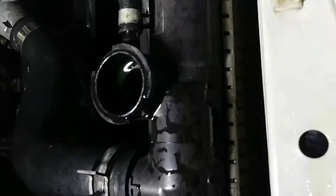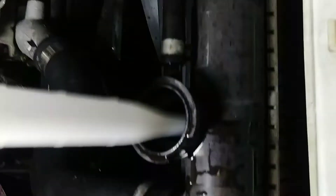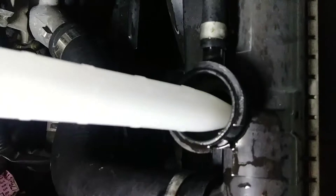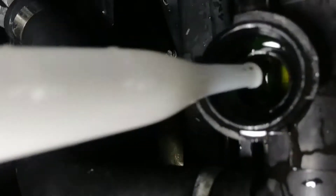This is how to test your block for a head gasket leak using the block tester. I borrowed this from AutoZone. Run the engine till it's warm, then bring the antifreeze level down with a turkey baster or drain some fluid out so it's below the inlet by a couple inches.